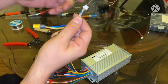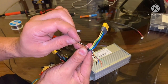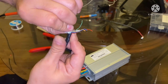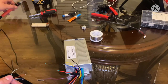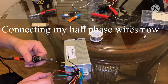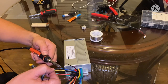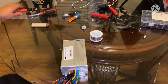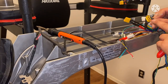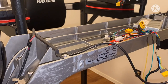These are all the hall effect sensor wires right here — we're going to clip this. The white wire right here is not going to be used, so just wrap that around or clip it — it doesn't matter, it's not used. These five wires here are all sensor wires — I'm going to go ahead and connect those now. That's that. All I'm going to do now is slide my heat shrink over it and cover up my points.